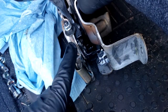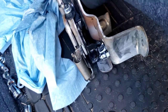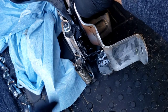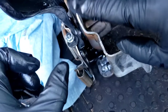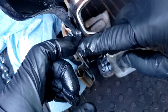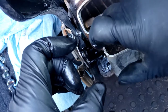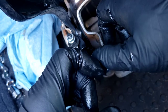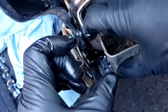I'm going to spray a little bit more and then reassemble it and you're good to go. Basically it was just dirt holding that little lock gear away. This piece has to stay down so it goes click click click and locks into each tooth of the gear as it turns. If it's pushed away it's a free-for-all. You want it down so every time you step on it, it clicks to the next tooth and stays in. When you step on it again it probably releases and that's how it comes back.